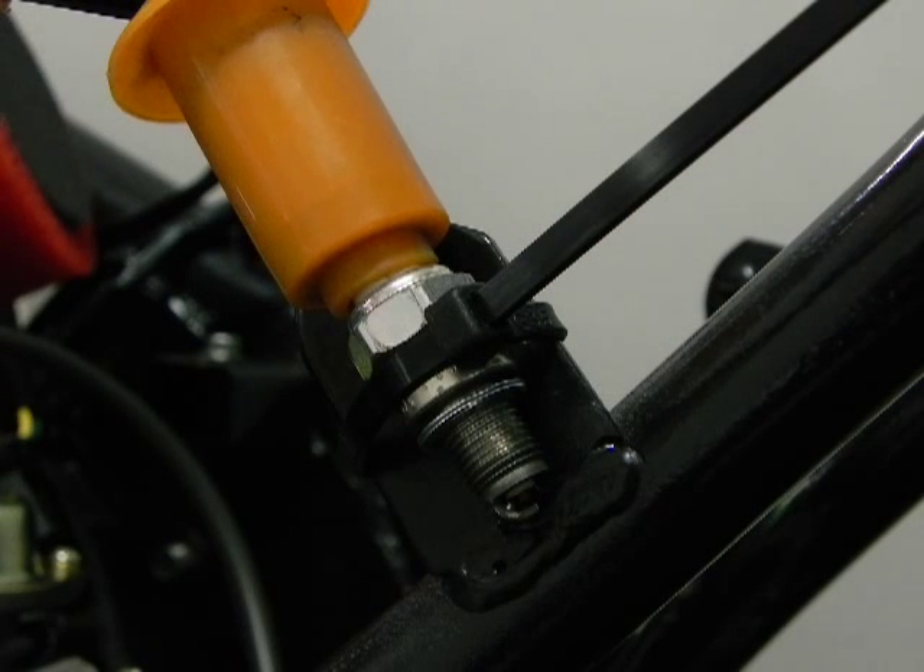One of the brakes must be pulled in to complete the circuit to perform this test, so now we will turn on the key and hit the starter button and see if we have a strong spark. The spark should be bright blue and not a weak orange or yellow, or absent. And here we had a nice blue spark indicating that we have a good ignition providing plenty of power for the scooter.